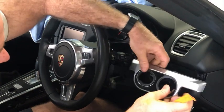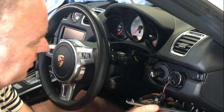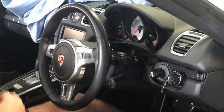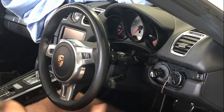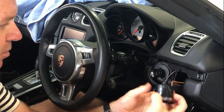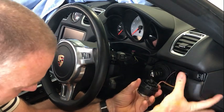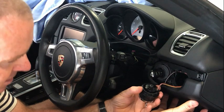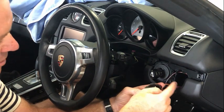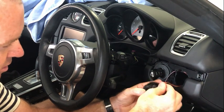And that'll just come straight off quite happily with the key in it. There is the electrical connector just for the light, so I'm just gonna pop that off on that side. If you need to replace the light switch, that'll actually just rotate like that and just pull straight out. There's a connector, and if you're going to be pulling the bottom piece off here, because if you need to get underneath here, you're actually better off disconnecting as many of these electrical connections as possible, and so you can just pull that one off.